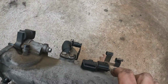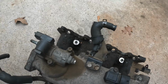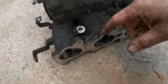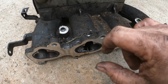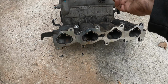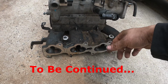And just here's all your connectors. Right there, and then the other ones are on the throttle body. But here's where your fuel injectors went in, right there. That was your two 12mm bolts, and here's where the bracket mount was, and then there's the last one. But that's everything on getting the intake out. Like I said, it is a little bit of a pain in the butt to get to these bottom 3 bolts, just because of the way you have to reach around the intake.